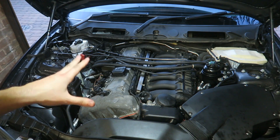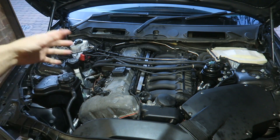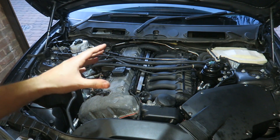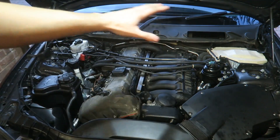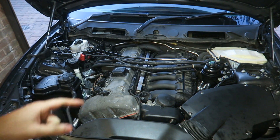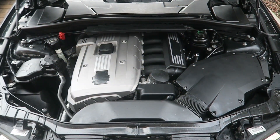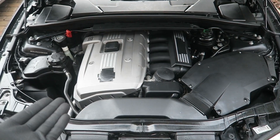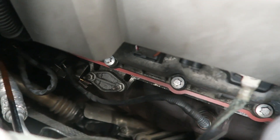I've reassembled everything I need to get the engine started. I want to try and fire it up, make sure it does fire up, make sure I haven't left any earth connections unplugged, and just make sure there are no leaks first and foremost. I'm not going to put the cowl back until I know that it runs and I have no leaks — moment of truth. Because the engine fired up with no issues, as you can see, everything is now put back together. The rocker cover gasket on this engine is now replaced, and if we take a look at the gasket itself, we can see we have no oil leaking. This is a successful job completed.